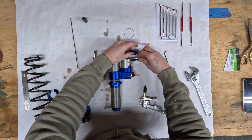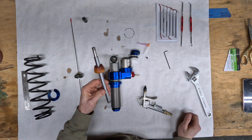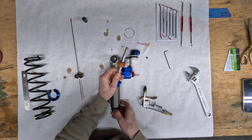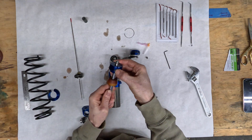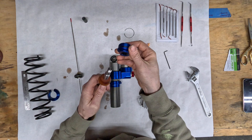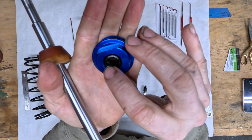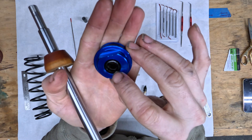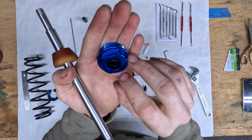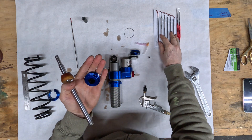Because I couldn't get the cap off initially, I knew I didn't have any leaks around there. My main issue was the bent rod — my shock was probably bent like this before I bent it back. I was worried about all the seals inside. You can see this area is a little beat up. I didn't see that part when I looked at the service rebuild picture, which is why I ordered the complete rebuild kit. I went to Harbor Freight and picked up a bunch of different picks to hopefully get that apart today.